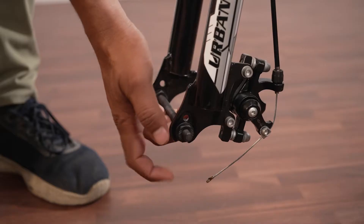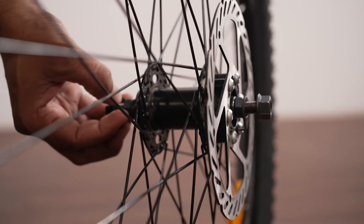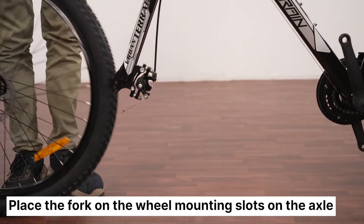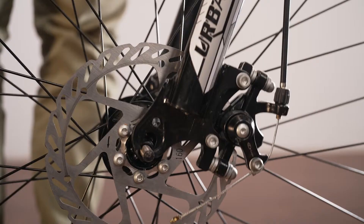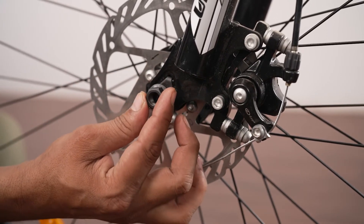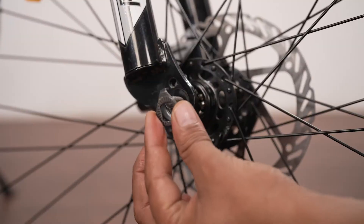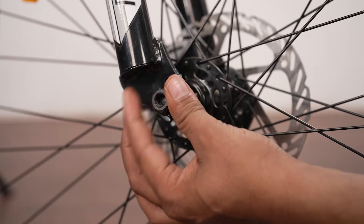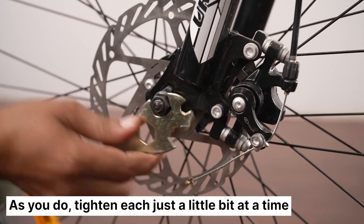It's time to attach the front wheel. Remove the fork protection bolt and the safety cap from the wheel. Before installing the wheel, unscrew the outer nut and washer from the axle hub, then place the cycle fork on the wheel mounting slots on the axle. Make sure to slide the wheel disc rotor in between the brake pads. Put the washer and nut on the wheel bolt, tighten it first with your hand, then repeat the process on the other side. Now use the wrench to tighten both sides properly.